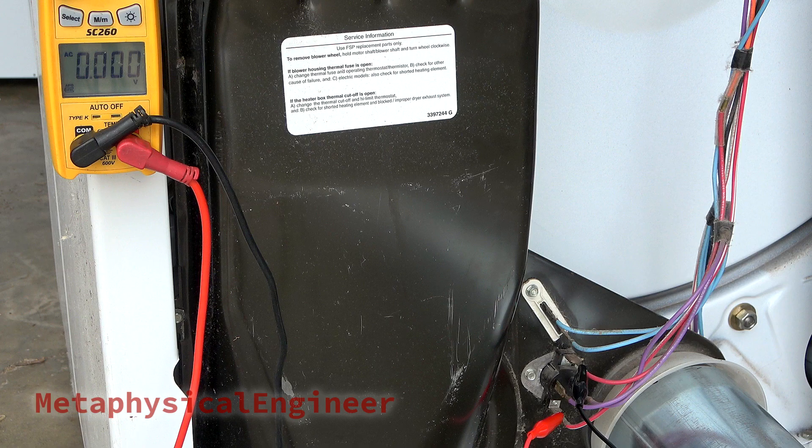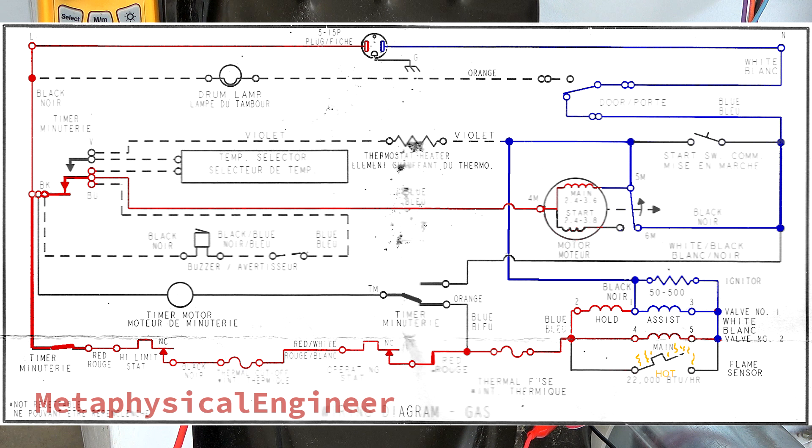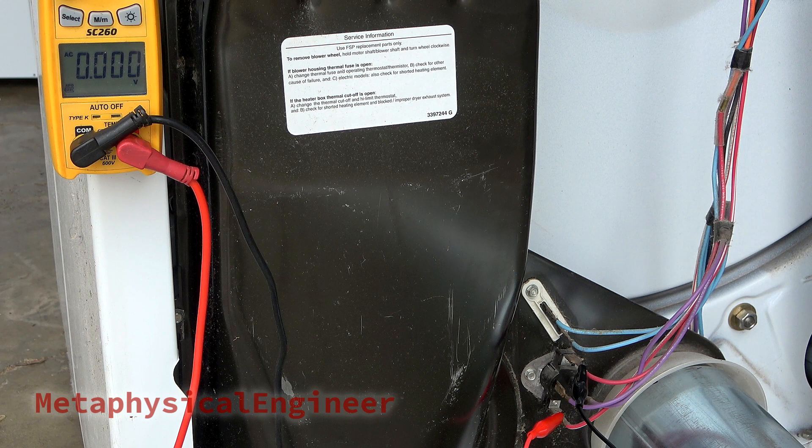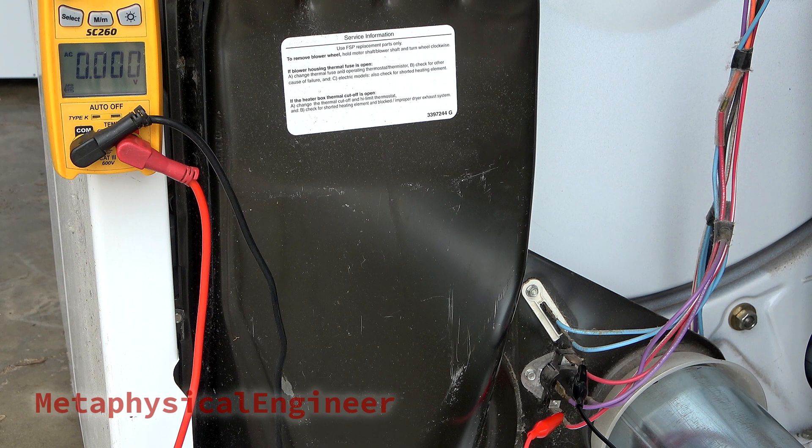The clever part is that the water in damp clothes is heavy and evaporation absorbs a lot of heat energy. Therefore, damp clothes heat up more slowly and cool down faster. The burner duty cycle is high while the timer duty cycle is low. As the clothes dry out, they heat quicker and cool more slowly, causing less burner runtime and more timer runtime. The dryness setting simply changes the starting point of the timer, biasing it towards more or less of these heat-cool cycles to control the ultimate dryness of the load. This is why the automatic function only works on the high heat setting for this model — the low heat cycles use a different set of contacts on the thermostat and would need additional components, including an independent temp selector and a thermostat heater to provide biasing at lower exhaust temps.